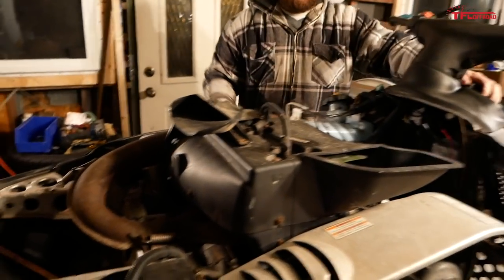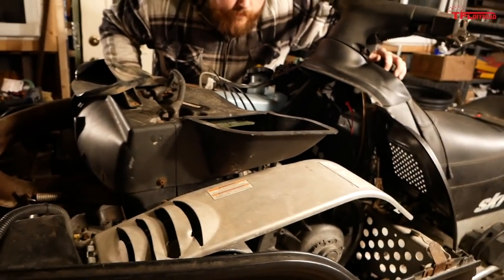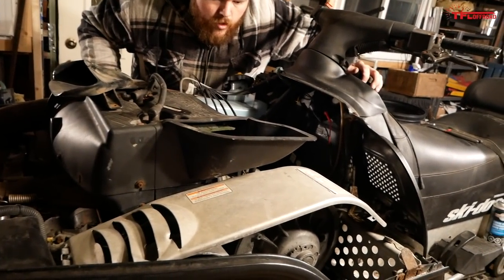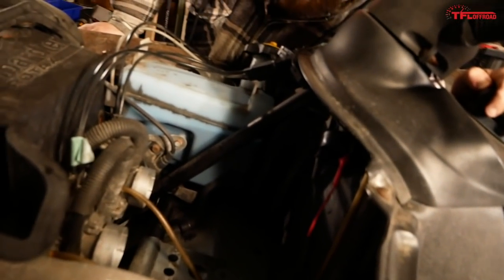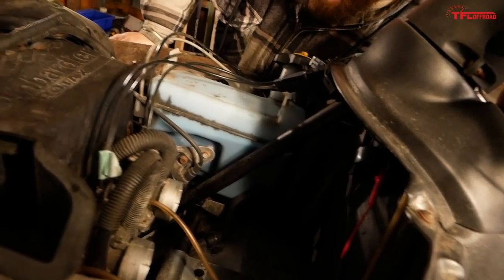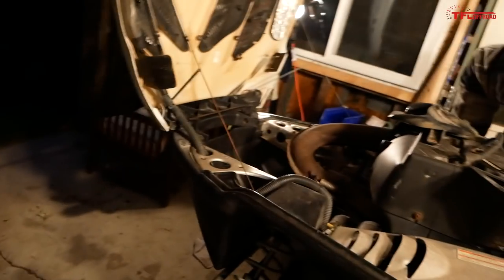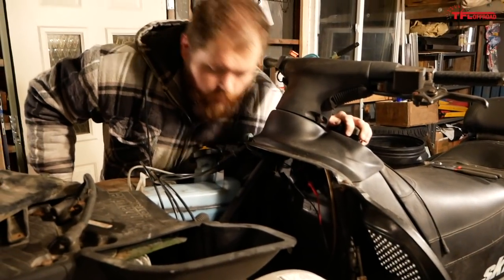No. Exhaust is back on. Yeah. There was definitely spark, but it seems like it's not pulling fuel right away. So I think the next thing I'll do is pull the carb back off and see if there's fuel in the bowl. Yeah, make sure it's getting gas. Never a problem before. And then we'll go back to the pump and we'll just trace the whole system backwards.